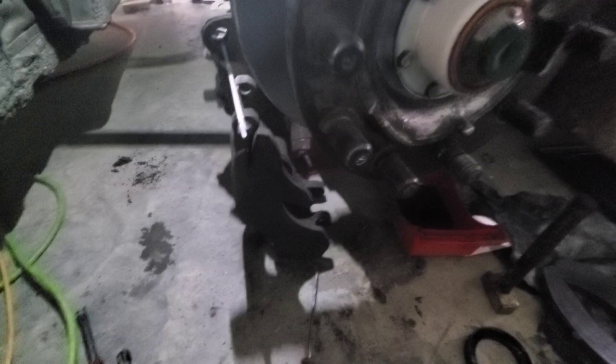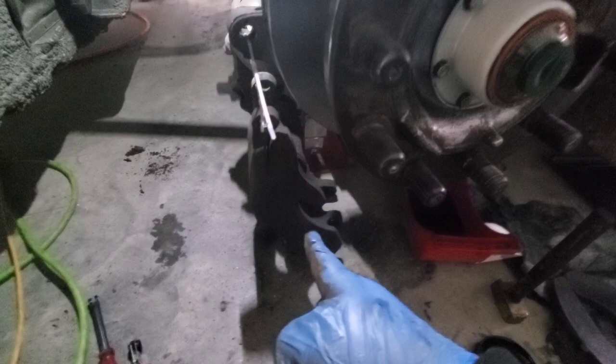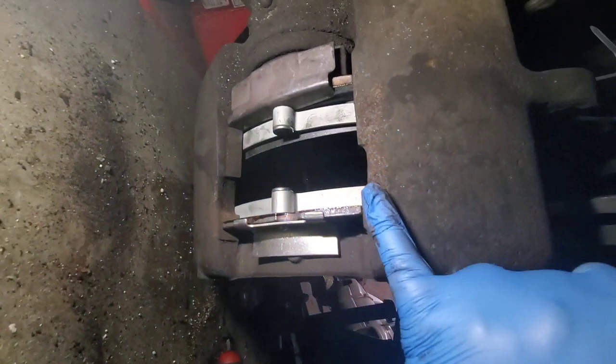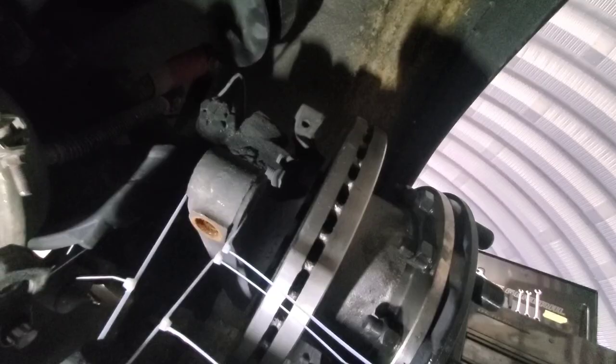Now this is where these really differ from the air disc brakes where the brake chamber comes straight into the back of the caliper — those you load from the top, kind of like most 6-8 piston calipers in the market like performance brakes. They have a pin that goes through and they just slide down from the top. These you actually have to load from the inside, so you have to take the caliper off to do these. You can see the recessed area here and here. I usually load the inside one first because it slides back and gives you more room, since this one does not clear the friction surface. I've got the caliper all the way compressed so that's opened up as much as it will, and now we're going to get it put up in place back in its brackets.